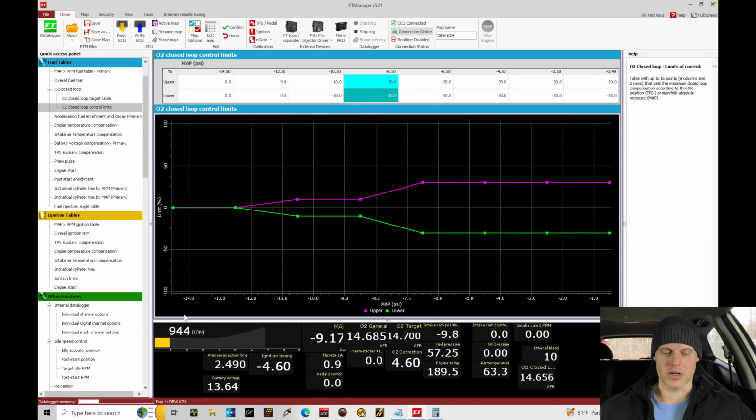So now what we can see here is we're idling pretty close to the desired target, 950, 900, 1000 RPM, and throttle blade opening, we can see that's pretty consistent. We see the ignition timing again. We'd like to see that in the positives, but I can't reduce that throttle angle anymore. I don't believe I have a vacuum leak somewhere on the car, but taking a look at that, the fan may have come on. I believe the fan actually turned on.